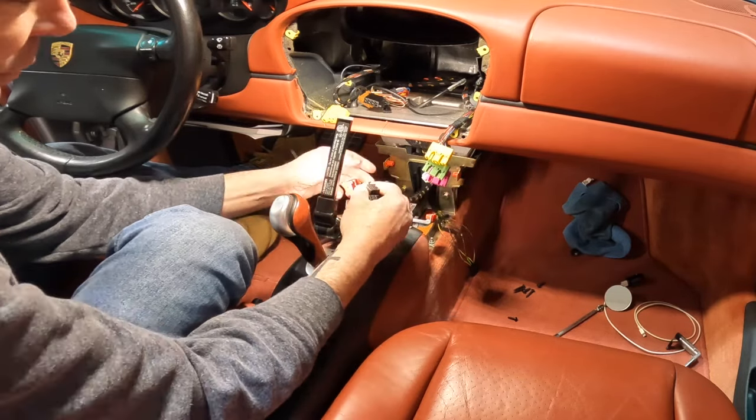But let's go ahead and take the rest of this off. This is going to take the whole button out, so don't freak out when that comes out. But this is going to give us access to the T20 Torx here and a T20 Torx here. The only two screws holding this gauge cluster on, and then you gotta kinda pop it up. Might wanna have a magnet handy. Now, if you really wanna take this gauge cluster out, you have to take this out. There's two pins here, and it'll slide back for you, as well as the actual connections to the gauges. The best way to do that is lean it forward and work from outside the windshield so you can see it. Very easy plugs. It's just a pull up the tab and it slides right out.